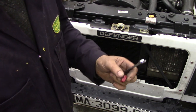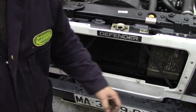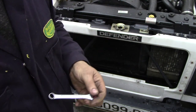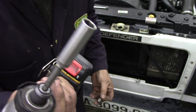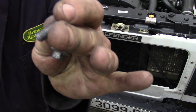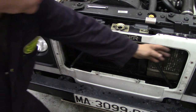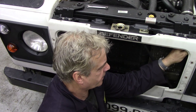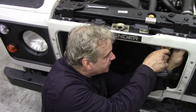Now to get the front panel off — I always take the front panels off because it's easy to get the engine out. You've got to take these two plastic nut things off the bottom here. Simply get a 10 millimeter spanner, work it up and it'll compress so you can push it out. Next, take the screws out the bottom — there's two 10 millimeter headed screws. That's where the extended bit comes in handy. Then we're going to take the four screws off here, and there's two screws underneath. We've got the gun here so we'll take those out — don't need to take them out completely just yet, just back them off.